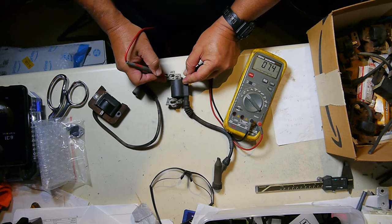Another thing to look for is the diameter of the flywheel. On a smaller flywheel you'll see a more pronounced curve on the magneto. You can tell by the curvature which flywheel diameter a magneto was made for. If you put a small-flywheel magneto with heavy curves up against a big flywheel, only the two edges of the poles are going to be even close. Also make sure you have room for where your kill switch connector is.